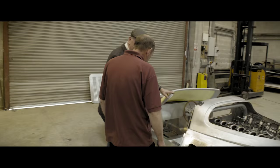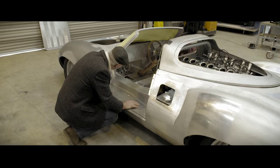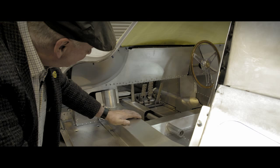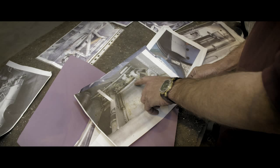Hi Paul. Can you tell me how you got the pedal box in? Basically we've done it pretty much the same as the original was. It's fully adjustable on the slides. These are just covers to cover up the suspension arms — undo the four bolts, move it to the position you like. You're a little bit limited on the length obviously because of the monocoque. If I show you some pictures of the original — this was the original pedal box — literally copied exactly the same. Even down to the Avdell rivets with the sprouts sticking out, which they didn't bother to grind off.